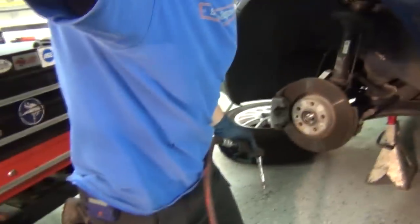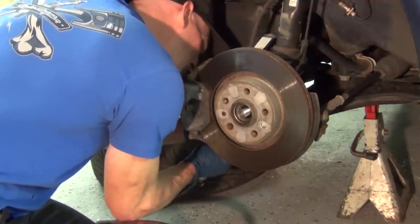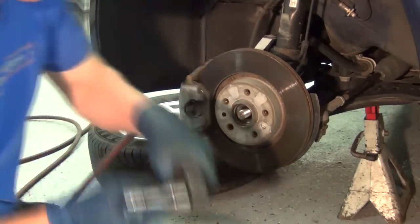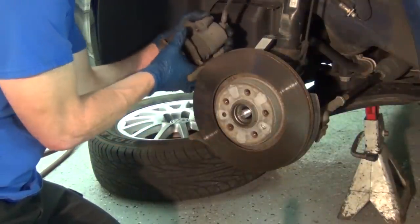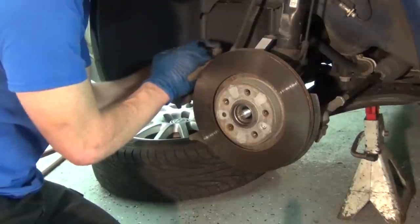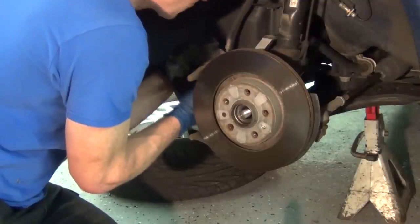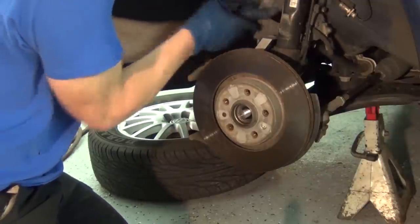Come from this side — you can see you've got those caliper pins on the back, so I'm going to pull those off. Pull this out of there. It's got a brake pad sensor on the inboard side, so I'll go ahead and unplug that. I like to set them up on the sway bar here, get them tucked up in there.